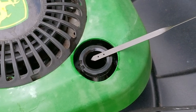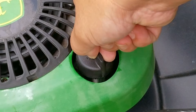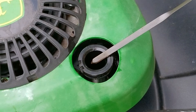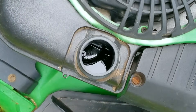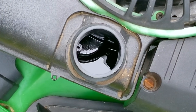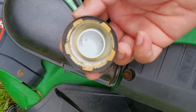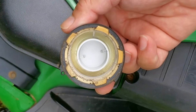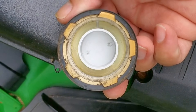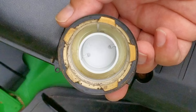I had to check and make sure that I didn't forget to add some oil to the engine because, let's face it, accidents do happen. However, it turns out there's more than enough oil in the engine, so that's not the problem. The other possibility is that it simply ran out of fuel, but again, you can see there's plenty of gasoline in the fuel tank. A better reason why it would stop would be a gas cap that was not venting air like it should be. But as you can see, the plastic gasket that's supposed to be there under the cap is not missing, so that's not the cause of our problem either.